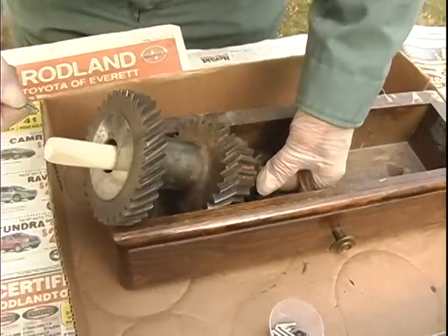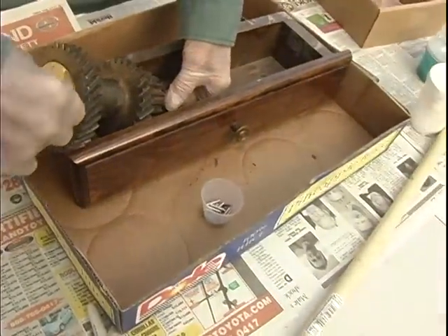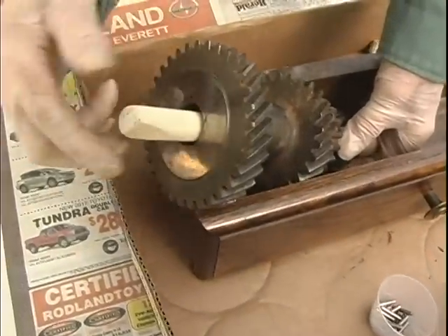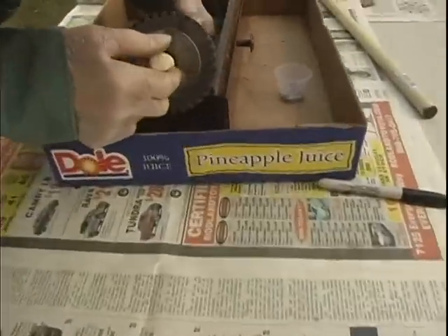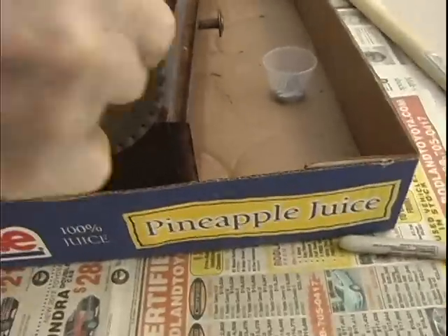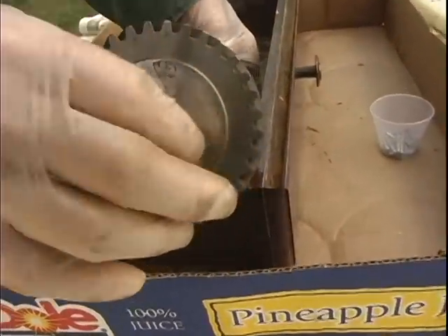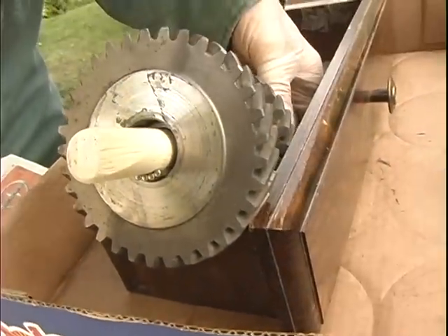Inside the cluster gear we've got the spacer. We have a dowel pin and we have all of our parts inside a cardboard box, and inside that box happens to be a drawer. We're using that to hold things up. The real secret to this is getting all of those dowel pins and roller bearings next to the dowel pin by having it at an angle — they just lay in there like logs. It makes it really easy to put them in there this way.